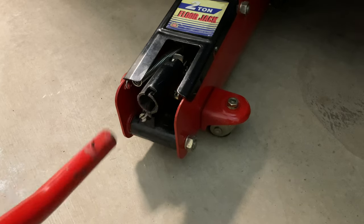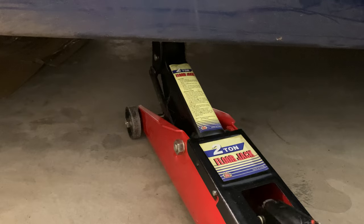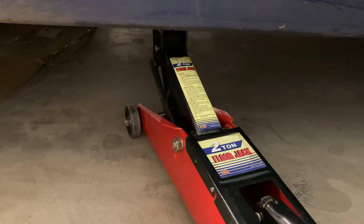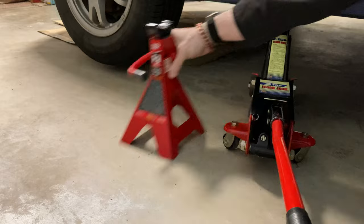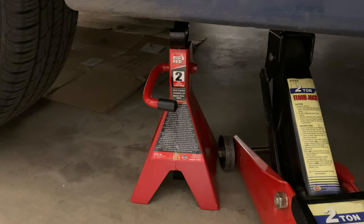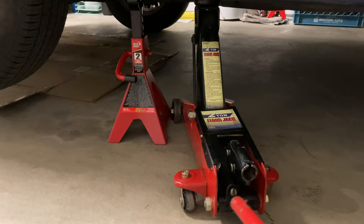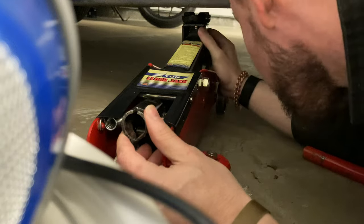Here we're using a hydraulic floor jack. I'm going to show you the process for lifting a car — jacking up that part of the frame like this. This is the process of lifting a car with a hydraulic jack. That's a jack stand. We're going to insert the jack stand. We have to lift it up enough, align the jack stand, then loosen the jack and send it across to the other side. We're going to repeat this process.